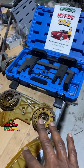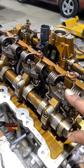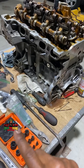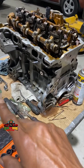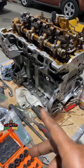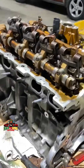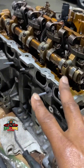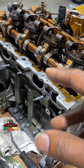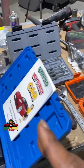I'm waiting on a tool to undo these springs — it should be here today. Once I have that, I'll be able to remove this and take the head off, look at the pistons, and get the block and head to the machine shop this week so they can start cleaning all the oil galleries. The engine had a spun bearing, so there are metal particles passing through the oil galleries going where metal shouldn't be. I'm curious to see what's going on under the cam caps. Taking as much precaution as possible to minimize problems going down the road. Thanks for watching, have a nice day.